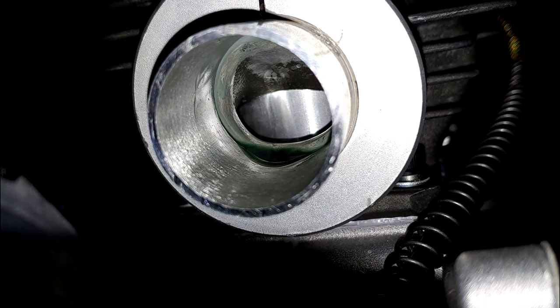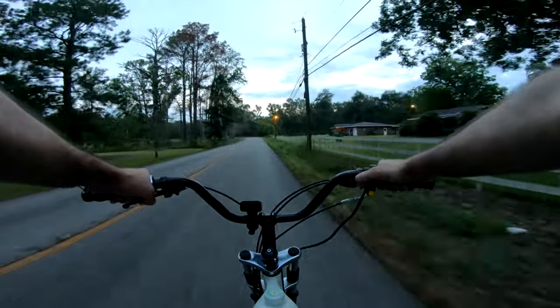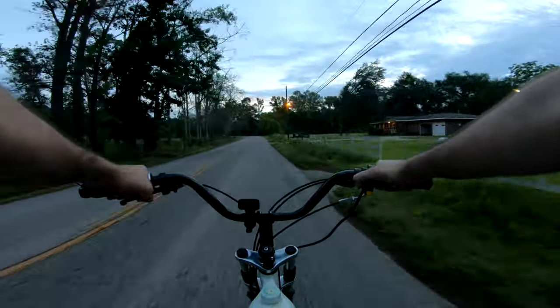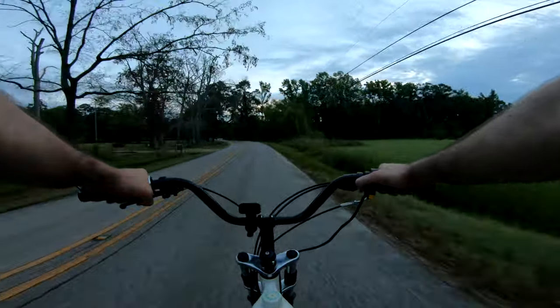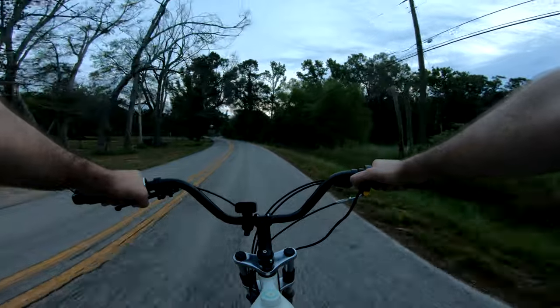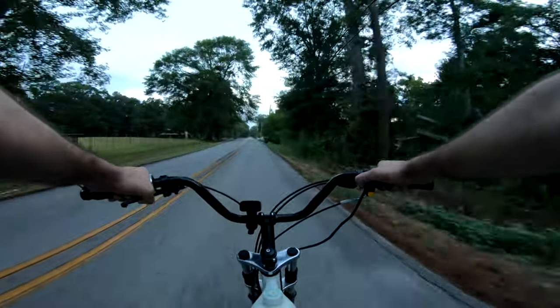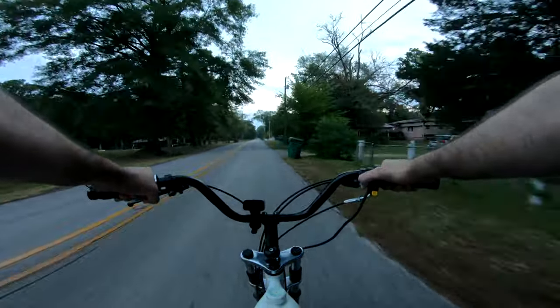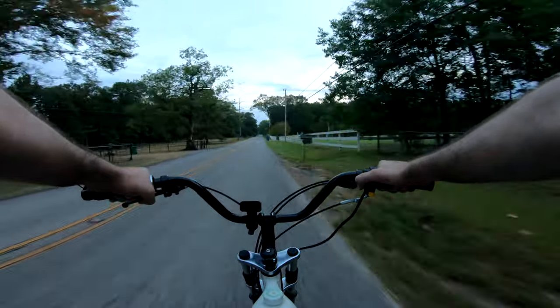I think the reason for this would be due to a lack of fuel atomization in the radiator hose itself. I'm assuming that this puddle would slowly fill up and the vibration from the motor would quickly dump it into the intake, causing it to flood and stall. I'll look for better alternatives for hooking this carburetor up to the intake, but I don't see this being a major issue in the long run, so I'm in no hurry.